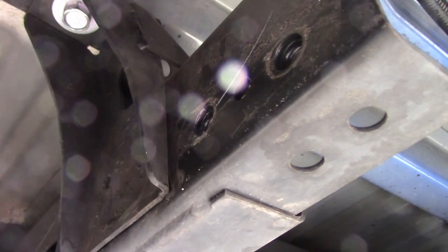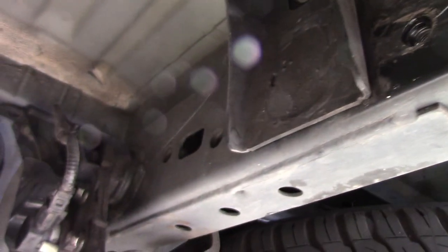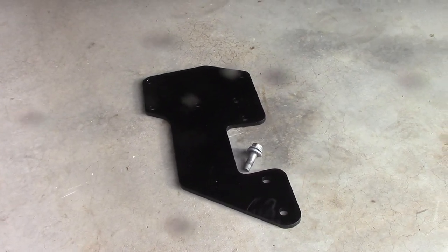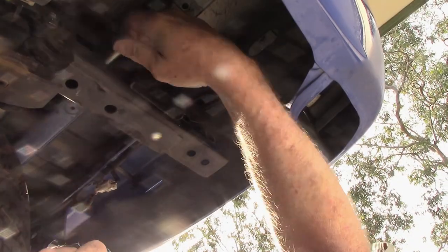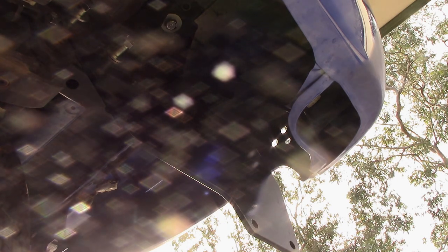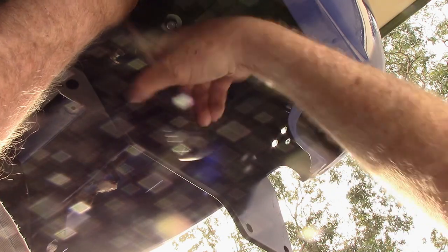This is a view up under the car. You can see the holes where the towbar was attached — there are captive nuts inside there. That's the bracket that comes with the towbar kit which we have to attach where the old towbar came off. The new bracket goes into holes a little further forward than the original, but that's okay — there are captive nuts in there. I did a test fit of the bolt to make sure the thread was clean; if not, a squirt of CRC is usually enough. Leave the brackets with a bit of flop in them at this point because you've still got to get the towbar onto them, and that movement makes the job easier.